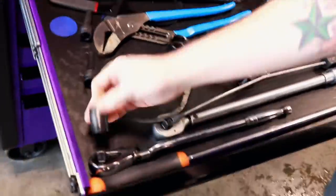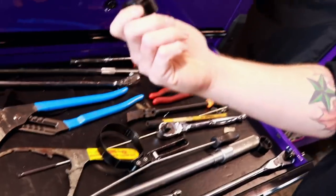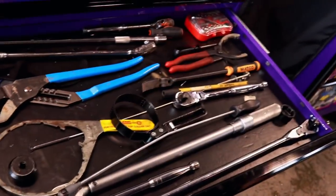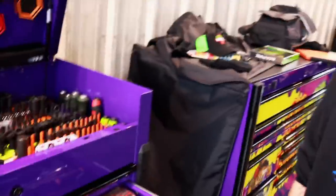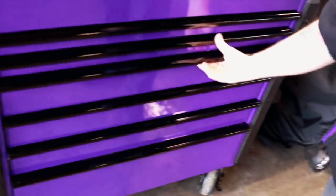This drawer is nothing but doing oil changes — you got your box sockets. And I've seen y'all look at these — those are little 36mm and 32mm for doing Paccar and DD15s. I've had those for a long time. I actually use a GearWrench ratchet wrench on the Paccar oil filter houses — it's easier. I haven't thought about getting an inch-and-a-quarter ratchet wrench, but that'd work — gets you in there without having to hit as much.